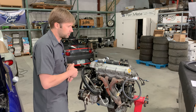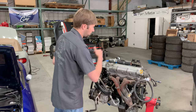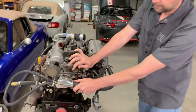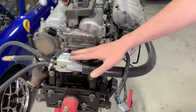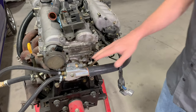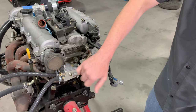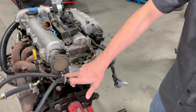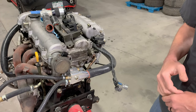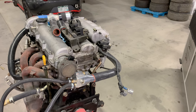There are lots of different ways to do a reroute. Some of them are scary, some of them are very good. This is our way of doing it. You can see this piece right here — it bolts on the back of the head in place. Basically the heater core outlet is what it is. It has a good fit with the EGR pipe and it has all of your sensors, room for your stock sensors. Your heater core comes out of here. This is a kind of junkyard engine that we use for testing lots of things, so apologies for it being a little ugly.